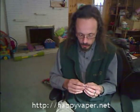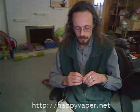Okay, this one came from IKEA. I have absolutely no idea where this one came from, probably IKEA as well. The diameter of the thread on this hook is just a little bigger than the diameter of the hole in the white cap of the cartomizer. So what you can do is screw it into the white hole. It shouldn't take too much effort, otherwise it'll yank out. And then you can pull out the white cap fairly easily.